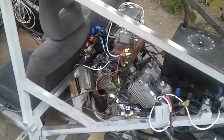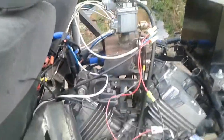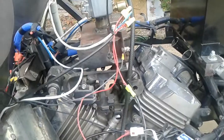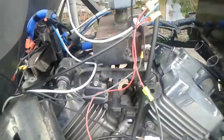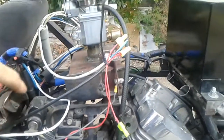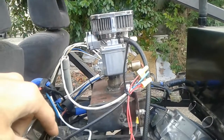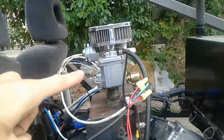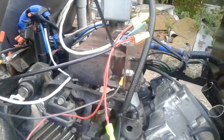My garage flooded about four or five years ago, and the carburetors got filled with flood water and gunk. To have them rebuilt was $350. I went online and found that people were running motorcycle engines like Gold Wings off Volkswagen carburetors from eBay, so that's what this is — a Volkswagen carburetor. The hardest part was building a four-to-one intake manifold.